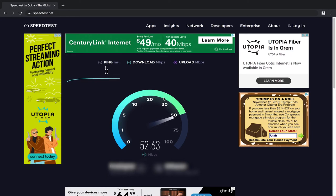So far we're getting some pretty significant gains — going from 12 all the way up to about 52 or 53 megabits on download. There's definitely improvement on the upload as well, going from 20 megabits up to about 53, getting closer to 55. There are definitely huge gains with the extender doing its job. Going through this step may take some trial and error to find the best location — I like to plug it in, run a speed test, then move it to a second or third spot and test again to determine the best placement for your area.